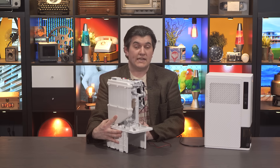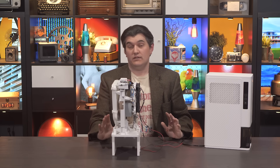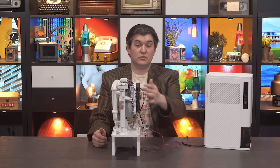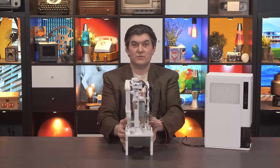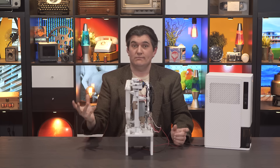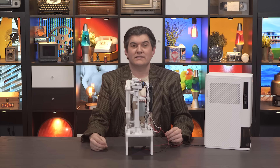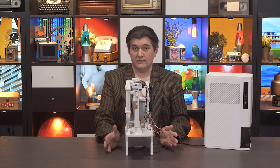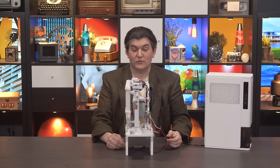First I just did a preliminary test where I had it exactly as you see it now — completely out of its case but powered on and operating. It didn't seem to care that I had disconnected the heater and the blower motor; it was working fine. So this 12-volt fan was running, pulling air this way. But it was completely out of its case, and that meant the airflow situation was not normal, and there would be very little airflow to cool off the straw radiator thing. So I literally just put a paint can here with a tiny little desk fan blowing at it and let it run for two hours as normal. In that time it extracted 60 grams of water, which was nowhere near what it can normally do. But that made sense because it's completely sitting out like this, so of course it's going to be a different number.